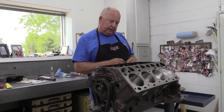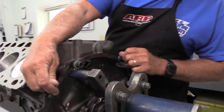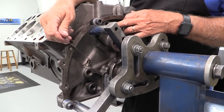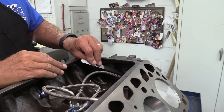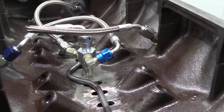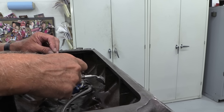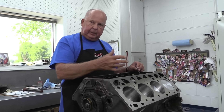What we've done — if you look around to the back here — this is the main oil gallery that oils the whole system. This gallery goes to the mains and then up to the cam bearings, but we've teed in here with a fitting. There'll be a hose that connects this bulkhead to get pressure straight from the main gallery, and then we've got a log right here. This goes down and it oils the center cam bearing plus the rocker arms. This will be the only oil going to the rocker arms now because it's blocked off at the cam bearing, so we're getting all that oil to the cam bearing and a constant supply of oil to the rocker arms.